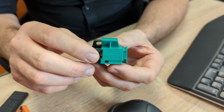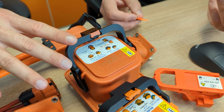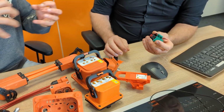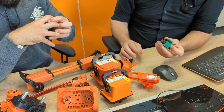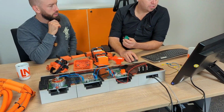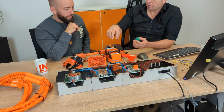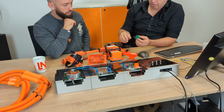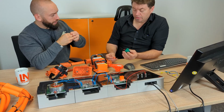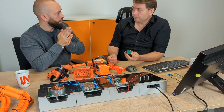What would this mean for those things when you want to make sure that no one else can re-initialize the high voltage system? Do you have to take away the upper part, or how do you make the protection here? Yeah, absolutely. That's a good point, and you can often put that inside of a safety box. Okay. So put that in there. And sometimes also with the key inside the safety box as well. And here you don't remove any part, everything is connected, and you just use the padlock in order to make sure that it can't be pushed again.